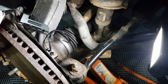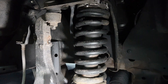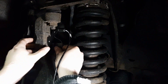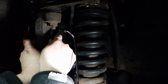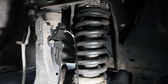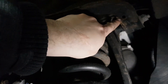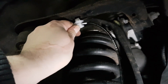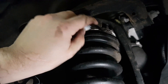The second piece goes in here. You will have a little locating pin which lines up with the hole — slide that in, line the hole up, again very easy. Finger tight on the bolt, then finish it off with your spanner or socket. Two retaining clips next — one in here, one in here — both come on the new assembly and they literally just push into place.